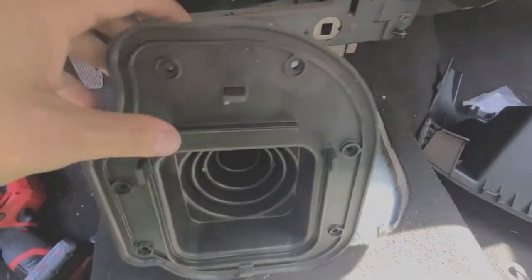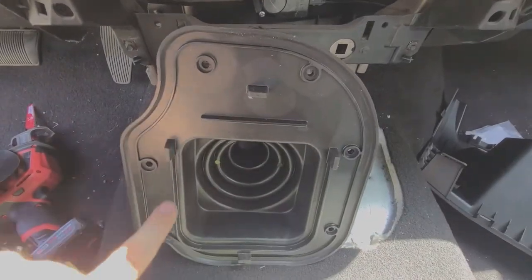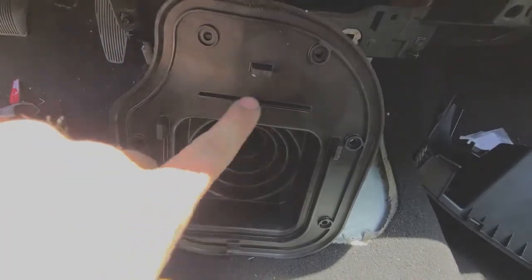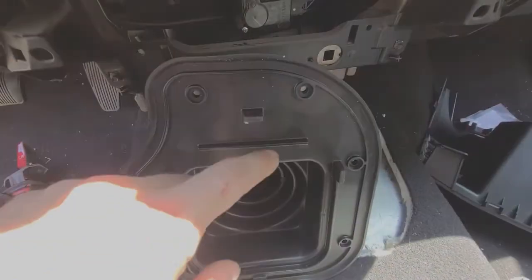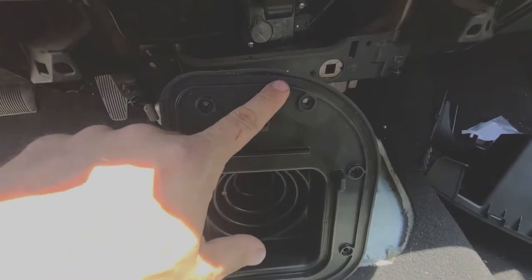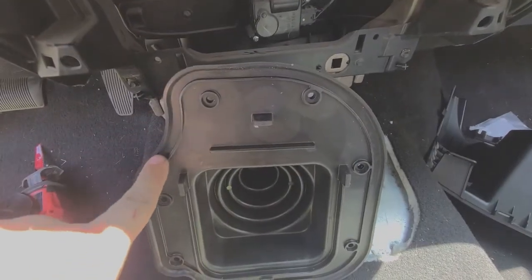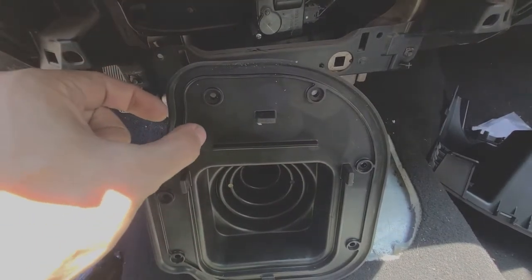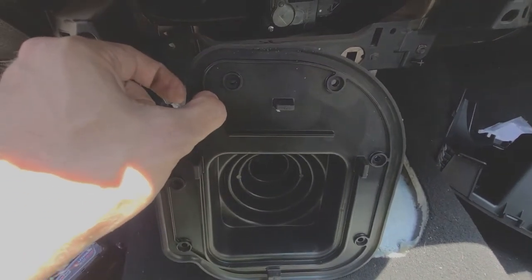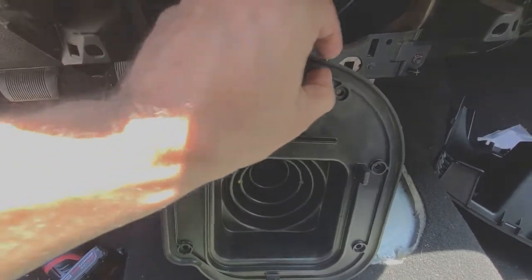So once I get that on there, I'm basically gonna draw straight lines around to each one and just kind of cut out a really rough shape. And then once I can get these down through the sheet metal so that this surface sits flat, then I'm gonna mark the outside of this with the Sharpie onto the sheet metal. And then I'll just kind of bring the hole in a little bit, like about 3/4 inch maybe, and then I'll draw another equal line in.